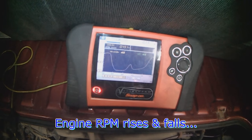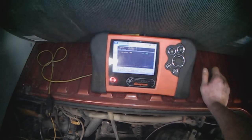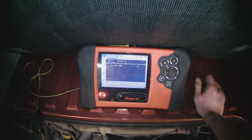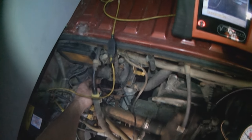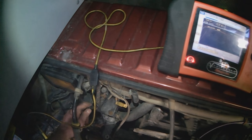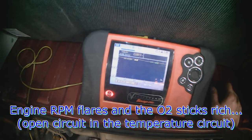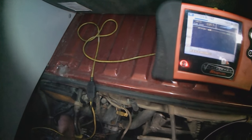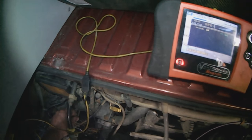So that's fuel shut off — it's going to catch itself. O2 is going to rise again and then it falls. Watch what happens when I wiggle the coolant temperature sensor wire — there it goes, and it sticks rich momentarily. The engine's flaring, RPM wide, there it's stuck rich. So there's a bad connection somewhere along here and that's causing it to flood — it's stuck at 900 millivolts.